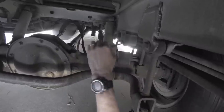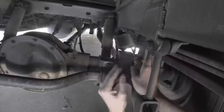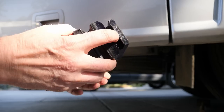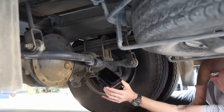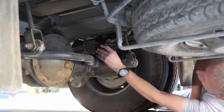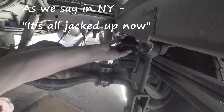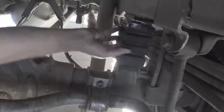Okay, now it's time to get these old ones off — you just pry them off. The deeper groove on this side goes up in the front, so it's going to go just like this. Oh, forgot to jack it up. Okay, got her in there. That's how the rear Sumo Springs work — now on to the front ones.